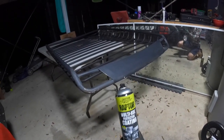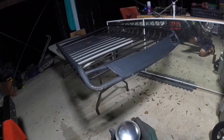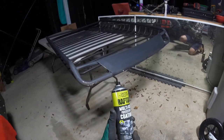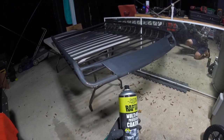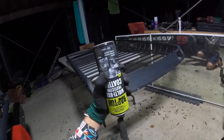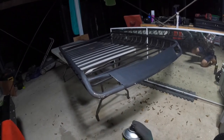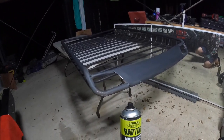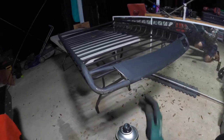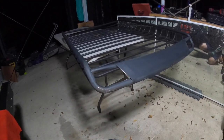After about two minutes of shaking, you'll notice a few dimples — indents in the bottom of the can. That's from the little ball inside the can and it pretty much means it's ready to use. This is a clog-free nozzle, but if you want to clean it they recommend inverting the can and spraying until no Raptor Liner comes out — that keeps the nozzle clean for next time. I recommend keeping the can about 10 to 15 centimeters away from what you're spraying and going smoothly in a nice, even layer.